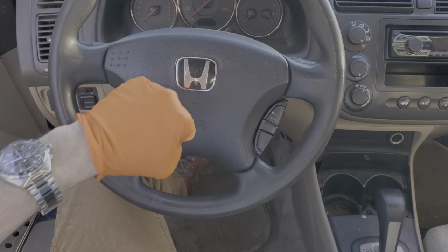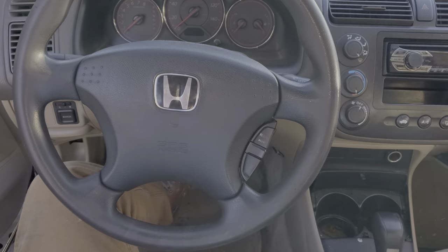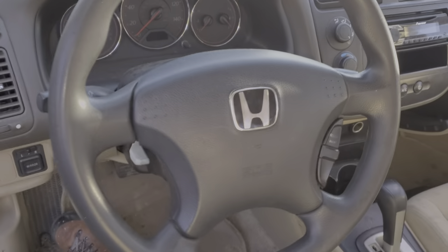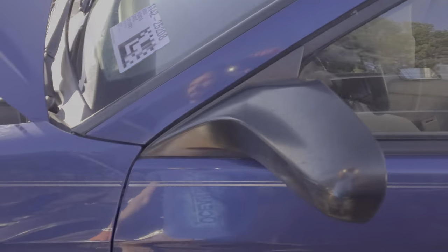As far as the brake light fuse, one great way to test it is to see if your horn works. If your horn works, then you know your brake light fuse is good because they actually share the same fuse. Let's go ahead and head under the hood — this is where we can find the brake light fuse.